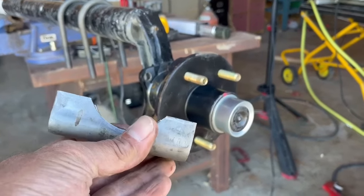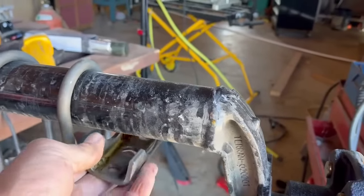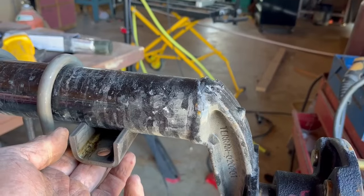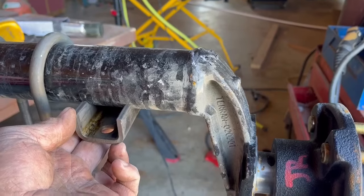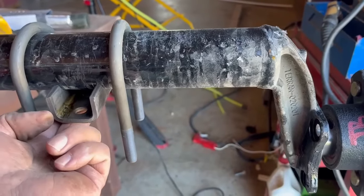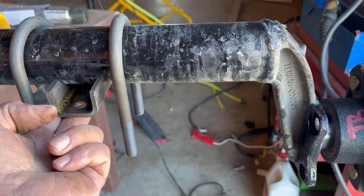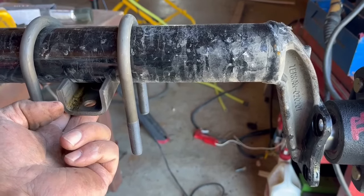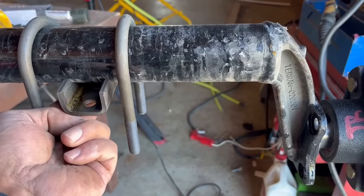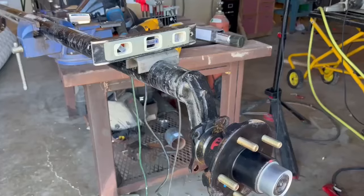It's just easy to get a whole new axle and install it. You'll also need one of these saddles — you'll need a set of two. Sometimes they come pre-installed and welded in place, so you'll need to know the distance between your leaf springs if it's pre-welded; that'll be part of the axle description. The u-bolts will sandwich down over the top of the leaf springs and that's what holds your axle onto the leaf springs and thus the trailer.